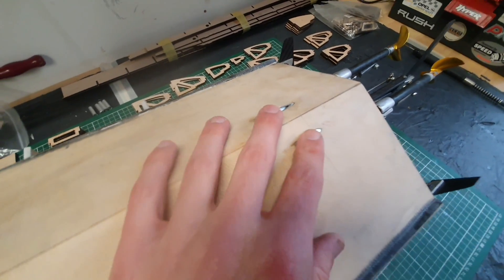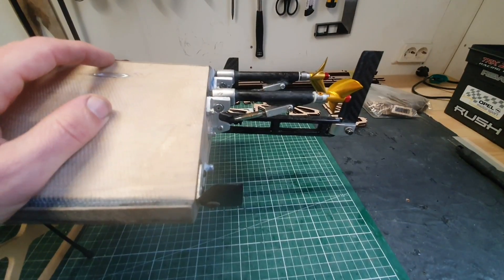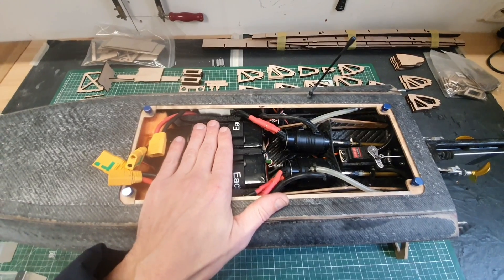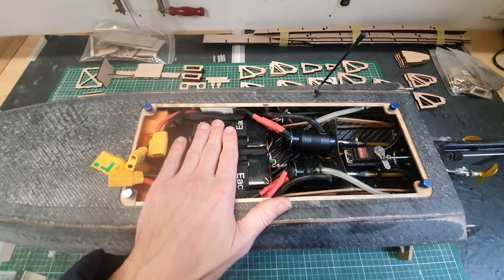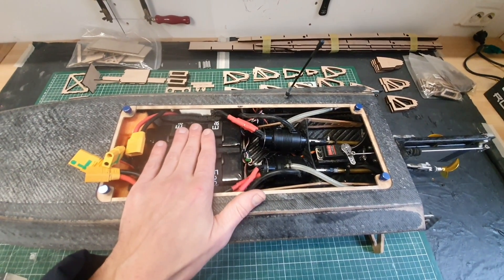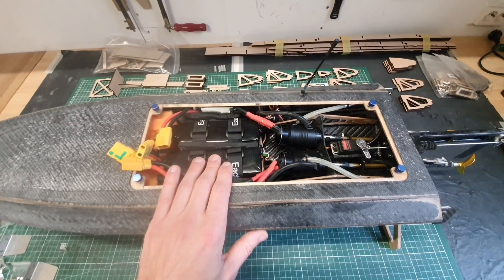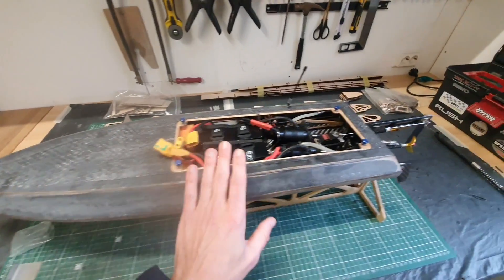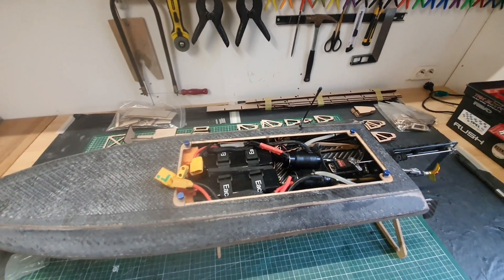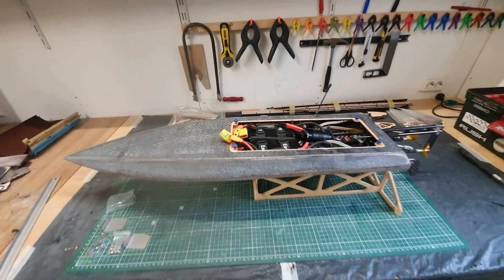The water cooling worked perfectly — I could see a nice flow of water from the exit tubes. The stinger drives also worked great. I was concerned that maybe the angle would change because the turnbuckle would run loose, but it didn't happen. The runtime with these 3000mAh LiPos was surprisingly good. I didn't expect I could run for about 4 or 5 minutes. Maybe with larger props the runtime will reduce to 3 or 4 minutes, but I'm totally fine with that — speed is more important than long run time. I will finish the boat with some nice paint, thinking about fluorescent orange, and maybe a small cockpit hatch. So there's definitely more to come — tuning, running, finishing it. Stay tuned, and I hope to see you next time. Bye.